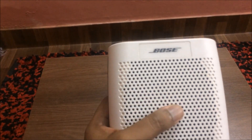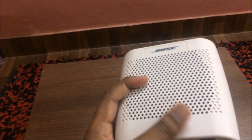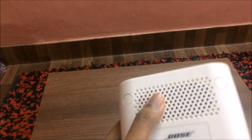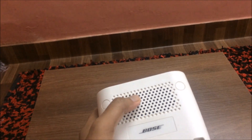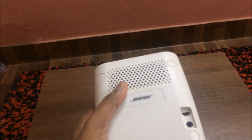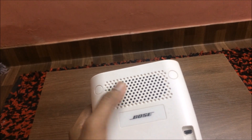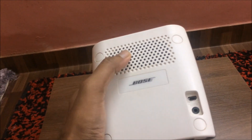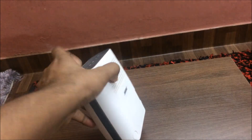Now this is the speaker right here. It's a mono speaker, not stereo. The bass comes from the back — it has a single passive radiator, whereas the SoundLink Color 2 has dual passive radiators. Passive radiators help produce a deeper sound from the woofer, which is why the SoundLink Color 2 has a slightly better bass — but it's still not by much.